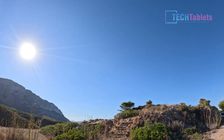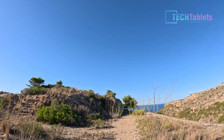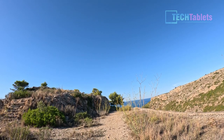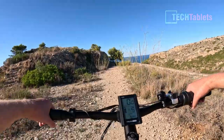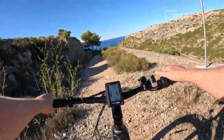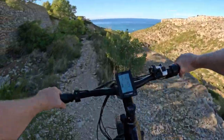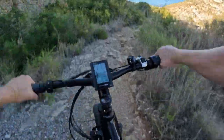I made it up to the top but ran into a problem — it gave me an Error 10 on the screen and I lost all power. I think it's because I was using pedal assist level five for the whole climb and it overheated. The motor was scorching hot. I let it cool down for two minutes and now everything seems fine again. Going downhill off-road with those four inch wide fat wheels and 26 inch rims, it's quite good at soaking up rough bumps. The front shock has a couple of times struck the mud guard because of the travel, which is a little off-putting.